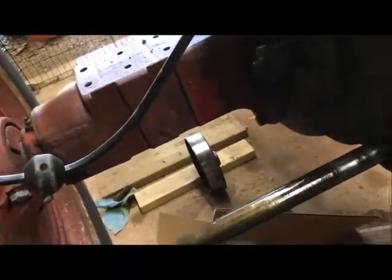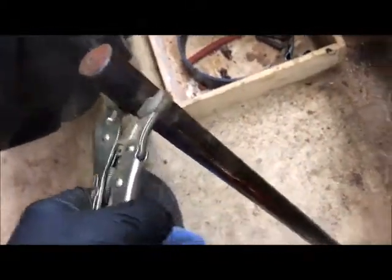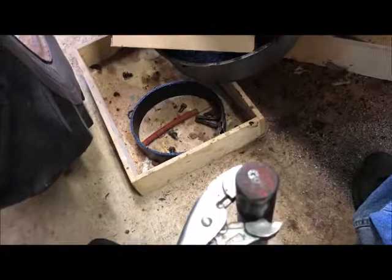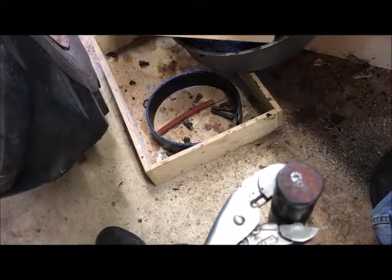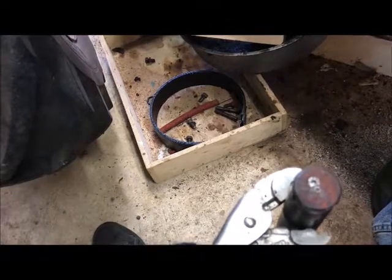Success after much tapping, twisting, and polishing on the far end. Here it is. It's ready to fall out, or so it looks like to me. If I can get those last few, there it goes. There it is. And that was the washer that stays on the right-hand side, but you can see it's basically a solid steel shaft that goes all the way through to activate the right-hand side brake and to let the clutch pedal ride on. The right-hand brake just rides on it as well to activate the right brake.